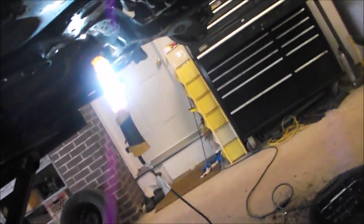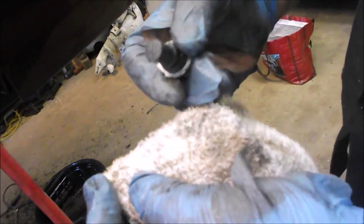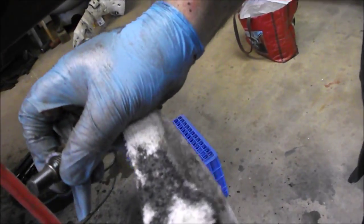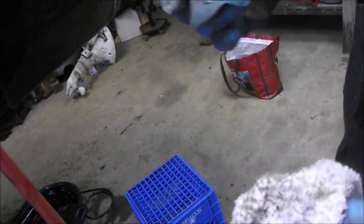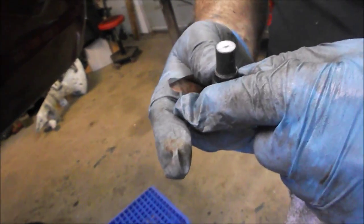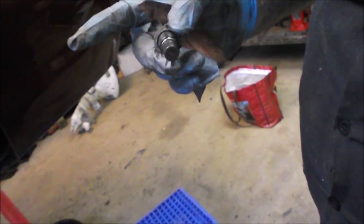Since we're taking this transmission out, we wanted to drain the oil - you want to put new transmission fluid in anyway. This should ideally be changed every time you remove the plug. When you remove the plug you'll find a big sludgy amount of metal mud basically - this is the remnants of it that I wiped off. It actually ends up looking like aluminum anti-seize but blackened - that's metal from inside the transmission. The gasket is supposed to be around it but it's missing corners, so I'll have to use either this gasket or the one from the car with the bad transmission.